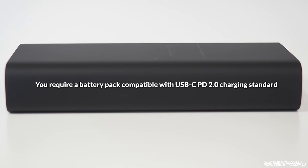So what do we need to charge via USB-C? We need a charger that's capable of the PD, or Power Delivery, charging standard — not any old USB-C charger will do. The chances are your mobile phone charger will not work. You'll need a PD charger that has a minimum output of 18 watts, but 18 watts will actually only get your Surface charging while it's off, so you really need a charger capable of a minimum of 30 watts.